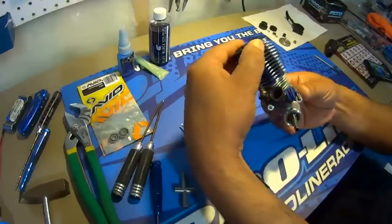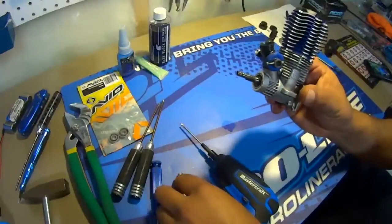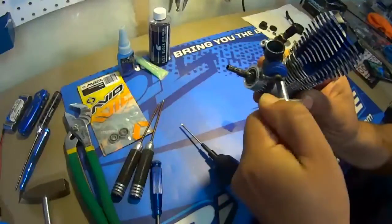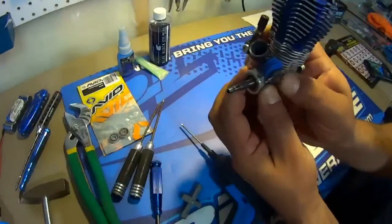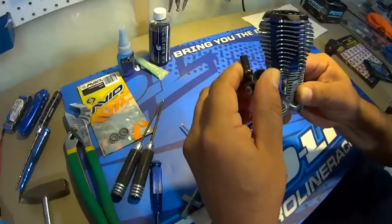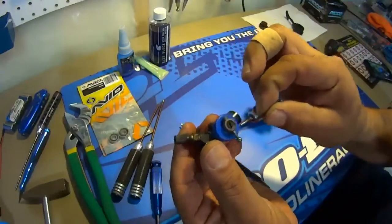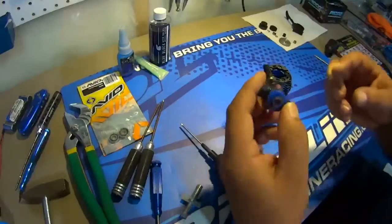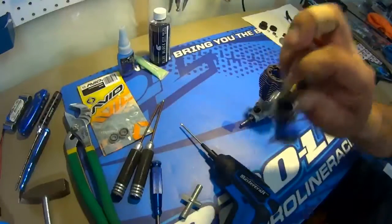Alright, for the carb on the 3.3 there's a little nut there, so I'm going to break that loose. I'll just use the Traxxas multi tool to loosen it off a few turns. All I do is give it a push to kind of break the seal, then pull off your carb. This one has been sealed so there's old silicone — get rid of that. Make sure it's all cleaned up, set that aside and we'll clean it up.